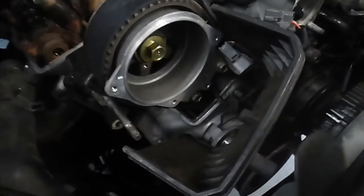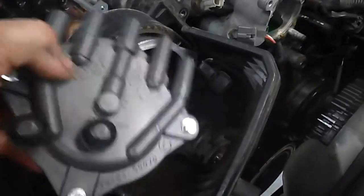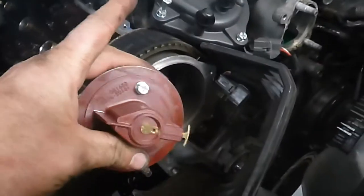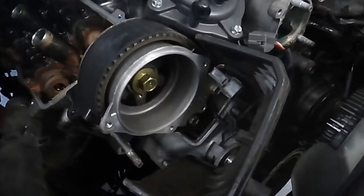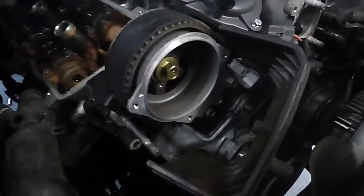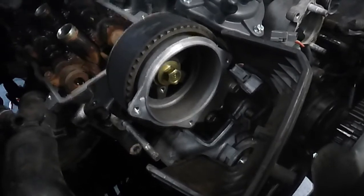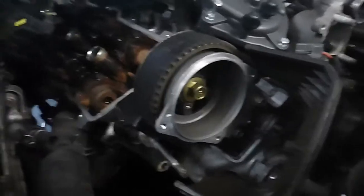So when you're doing a cam belt on one of these, it really pays to put at least new rotors in it, and often caps. I keep caps in stock — distributor caps, brand new, brand new Toyota. Same with the ignition rotors. Do them before they fall apart. I change a lot of them because these cars have misfires or other issues, so I change them then. But every time I do a cam belt on an early one, I pretty much always do rotors, and about 50% of the time I do the distributor cap.